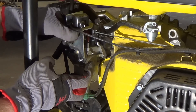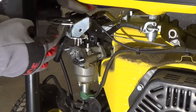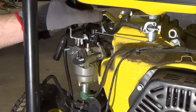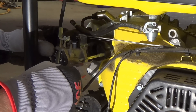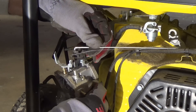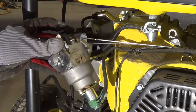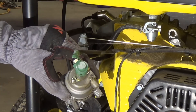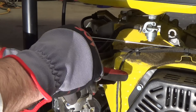A couple of pieces to the carburetor — see if I can get this apart without damaging any gaskets. The gasket came apart, but that's okay because it's not my engine. I'm going to pull this carburetor right off of its pins gently, because we still have some things attached that I don't want to bend or break. There's some kind of electrical sensor on the bottom — I'm going to grab a Phillips screwdriver to remove that. It looks like our bowl was full because fuel is draining out of here, but it's clean gas so that's fine.